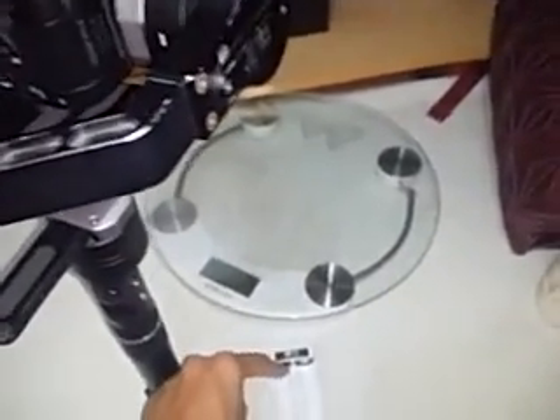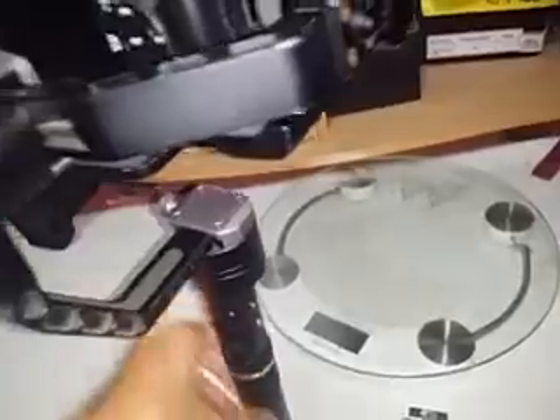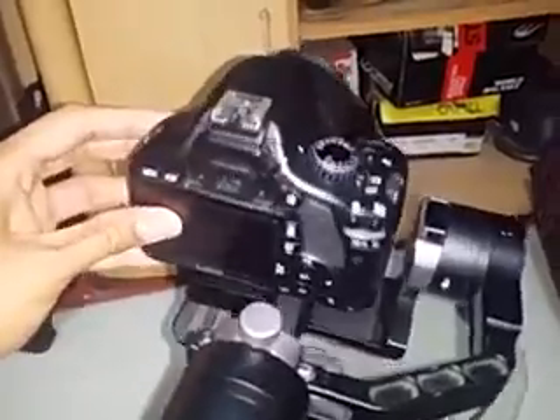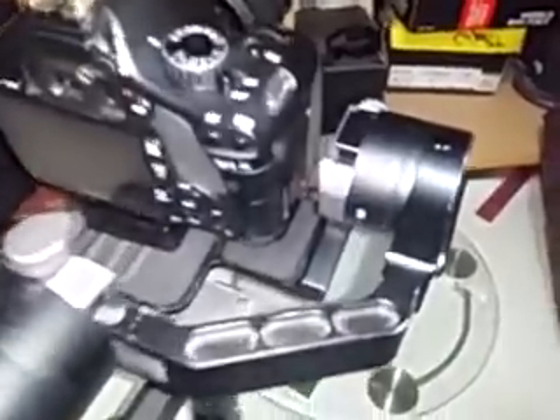You shouldn't charge this to 100%, because at full charge the gimbal goes erratic. I measured the voltage with a multimeter and each cell reads 4.16V fully charged, adding up to 8.32V total. But once each cell drains to 4.14V, the gimbal becomes stable — it turns on and doesn't go to standby mode. So it's a software issue triggered by a slightly elevated battery voltage.